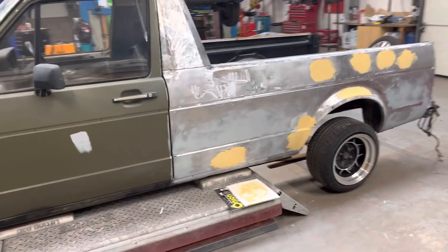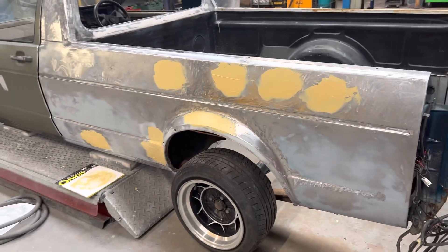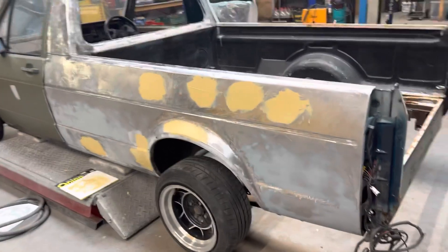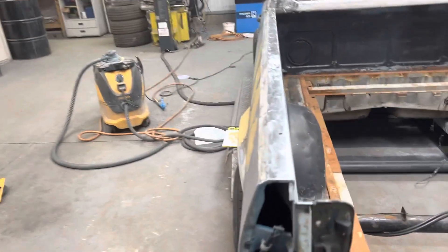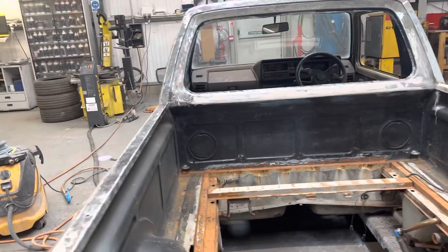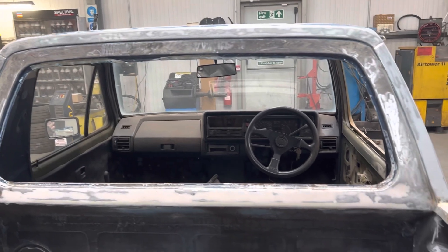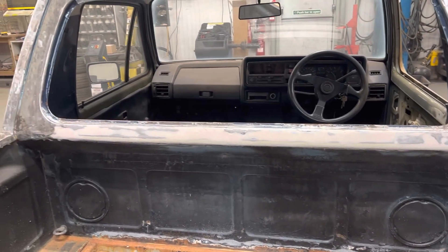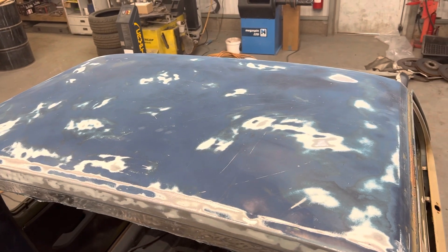So far I've done a lot of grinding and sanding on this passenger side. That's fill number three on those dents - I'll still need to do another maybe one or two just to get them properly smoothed out, but everything's coming up pretty nice. Ground and sanded all the tops as well. Also done all the window shuts, just because that's so awkward and time consuming - there was a lot of filler in there already but we've started tackling that. Also started on the roof as well, which wasn't too bad. There are a couple of deep scratches in there I'll need to feather out before we do anything with paint. This side with the gutter I've not done, but the other side I've done a fair bit more.